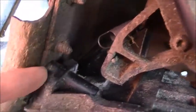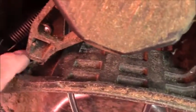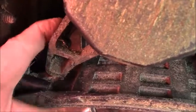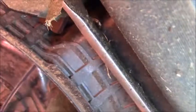So this takes a little bit of trickiness. Got to get a needle nose plier in there. So let me get that done. Okay, so the spring is in. I found it slightly easier to start with the spring installed on the plastic side and to grab the tip of the hook of the flange side and guide it two-handed into the hole. So it's in there. Let's get the rest of this cowling in.